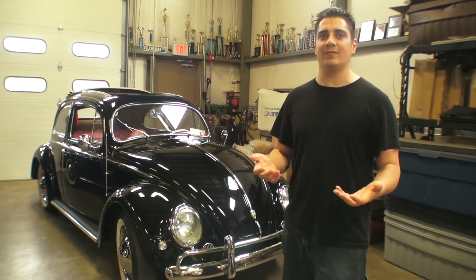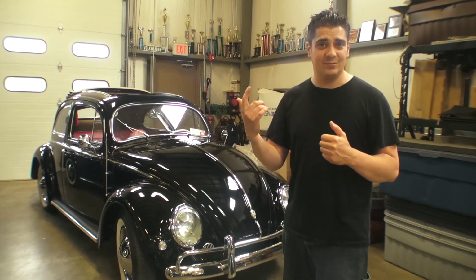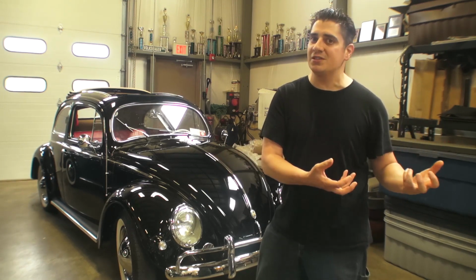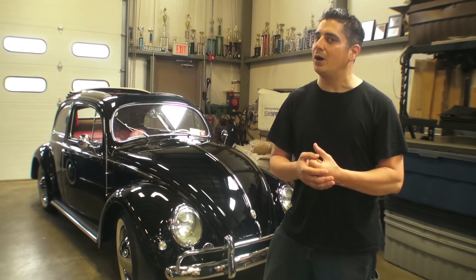But over time, we took the gas tank out, we checked and inspected everything. Everything was spotless pretty much. Our fuel filters were spotless. So the only thing that was really left was the fuel pump. And quite frankly, what might have happened was old junk that was in the gas tank might have gone through the fuel system and then got stuck in the fuel pump.